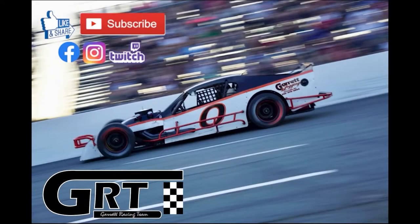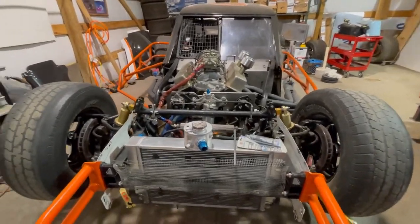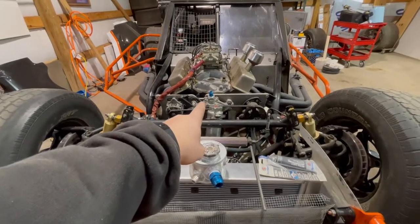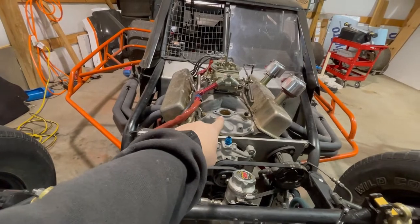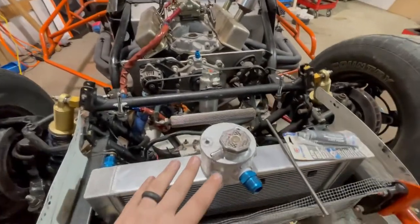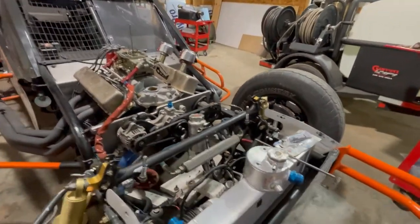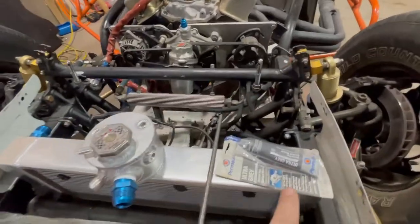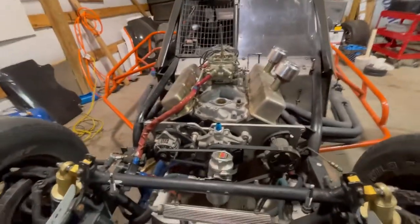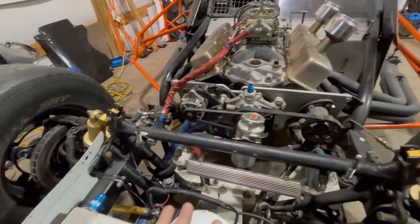Alright, let me give a quick rundown on the parts we're going to be using. To start off, we're going to put this new style expansion tank on my intake. Right now I have no expansion tank or neck or any of that. I've already cleaned this up - I took a drill with a wire brush and cleaned all the excess gray Permatex off. We're going to go back and put gray gasket maker on once we're ready, along with a rubber O-ring that will help seal the water off.